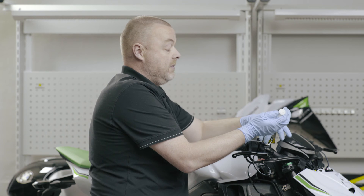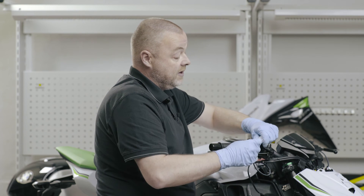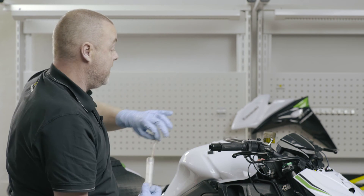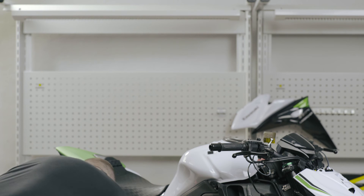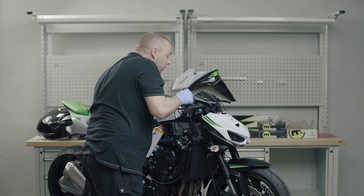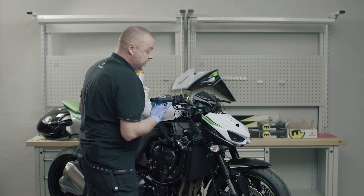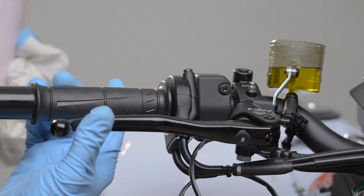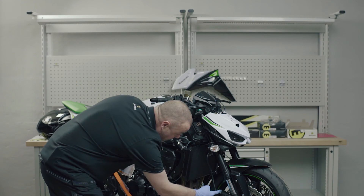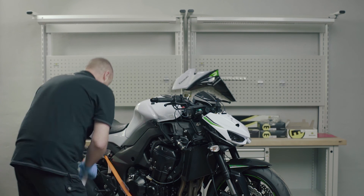A good trick when taking the syringe off — rather than spraying yourself and the whole workshop with brake fluid — is to create a vacuum within the syringe by pulling on it, so that when you lift it off, the fluid goes into the syringe and not all over the place. Have a look afterwards to see if there is any fluid left anywhere. I should now have a very hard pressure point — which I do. I can see there is no fluid escaping from the nipple and no fluid escaping down below at the caliper. My brake master cylinder is now filled, bled, and ready for action.